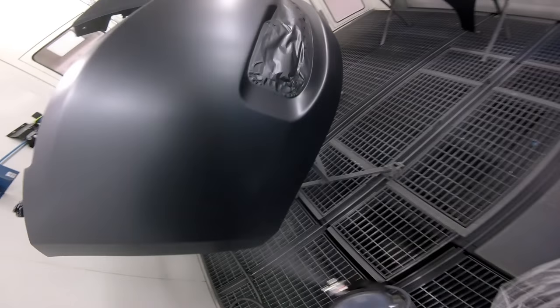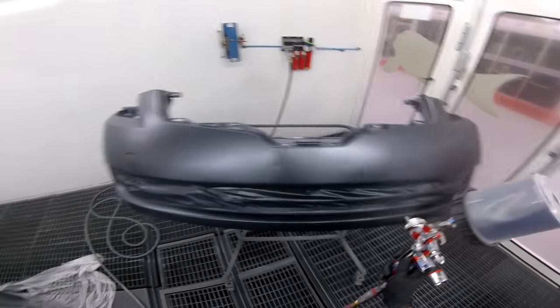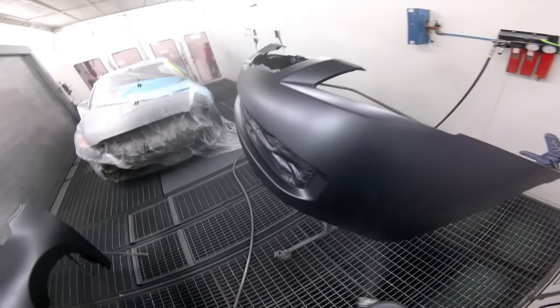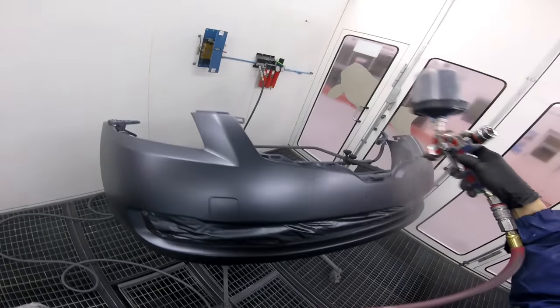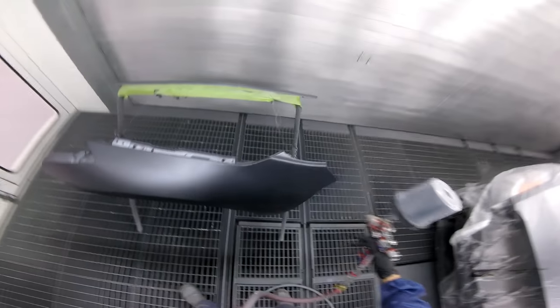What I'm basically doing is going up and then going down. You want to make sure you're not putting it on wet — I'm keeping a little bit of distance, I'm fairly far from the panel. What you want to do is create that silky smooth look to the panel. I let that first control coat dry up a little bit, then did another quick one — and that's exactly what I'm doing here on the fender. I have more videos on a control coat — just look through my channel. Welcome, this is Motivated Painters.